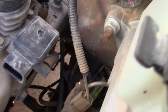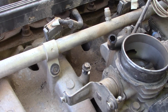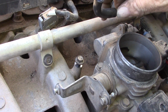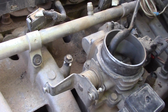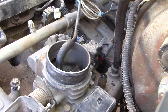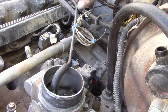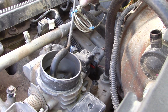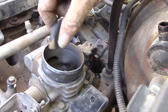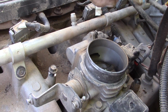The other thing you're going to run into, and you can see it right here, is that your rubber is going to be old and brittle. So plan on pretty much getting all new hose as you start. So this one snapped off at the nipple. I'm going to need some more hose, but I'll snip this off, get this wire out of the way, because I believe that was to the AC, which I don't have anyway, and I'm going to rewire it with a vintage air unit at some future date. But for the moment, all that's going to have to come out. So this is going to swing around that way, and I know I'm going to have to go down and get at least a small section of replacement hose.